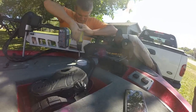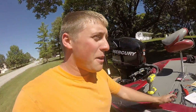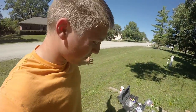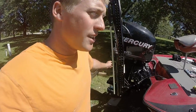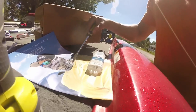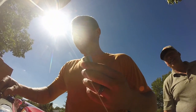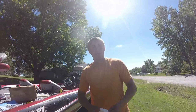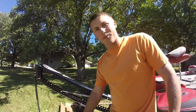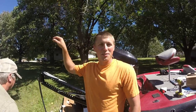There's one more step — we're going to install a little cap on the tip of the power pole to help hold the boat in place a little better. We're going to epoxy it on there, so you need to make sure you get one of those. We got some epoxy, mixing it together, then sticking it down in there and getting it all over the sides. We're going to leave it pressed against the ground for about a day so it hardens. And that's it — hope you guys enjoyed that, we'll see you next time on Fishing with Nordby.